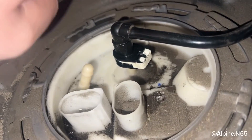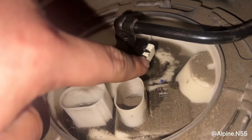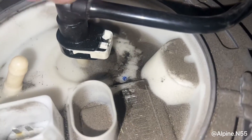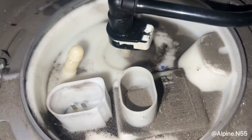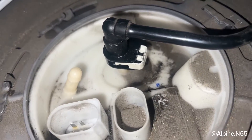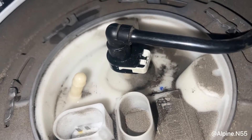The next step is to remove the low pressure fuel line. The way you do that is you pull out this back tab here, and then there's actually a button in the front that you will click down as you are pushing the line down. A little bit of fuel is going to pour out, but you need to make sure you have a rag to clean that up. Then the next step is to go ahead and install our ethanol content sensor.